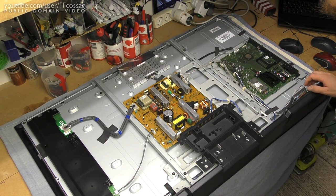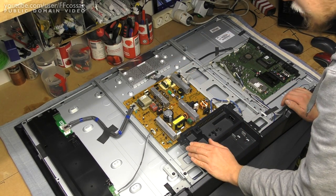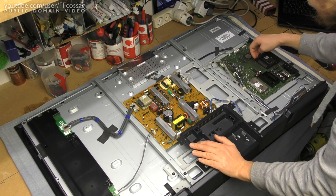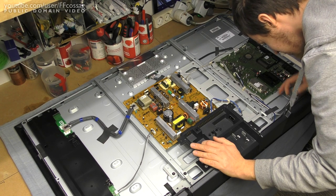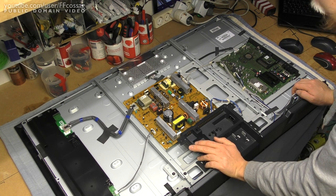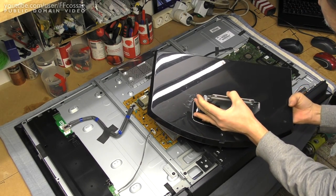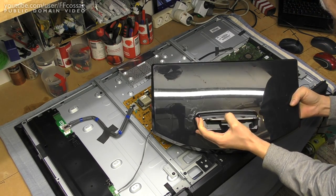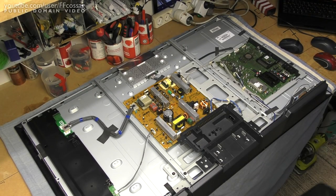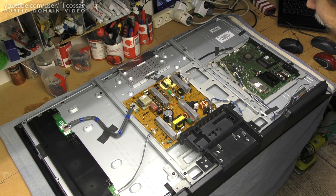Since we don't have any breakout board on this side - usually when you have tubes which are just sticks going across, you have a board on each side both going to the inverter. But yeah, this thing looks quite fresh. There's barely any dust in it, it's almost as if it's been cleaned out. Not even in the speakers. This thing's either been cleaned out or it's been very well kept - I'm almost betting it's been very well kept. The foot is in good condition, just a bit scratched. Usually the condition of the foot is a good sign of how well kept the TV is. Something I am noticing is that the panel is a bit bent and not very well supported, so we could have some solder joint issues on that.